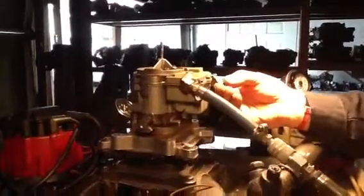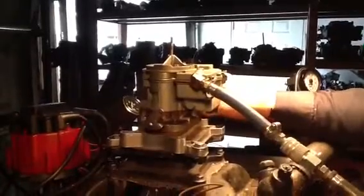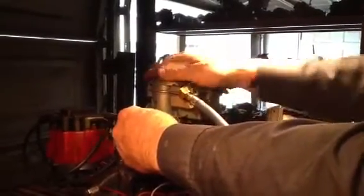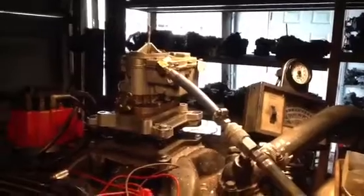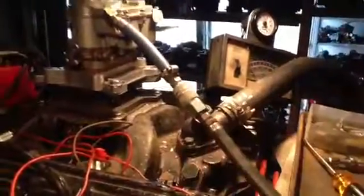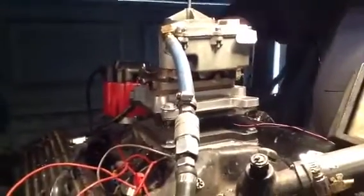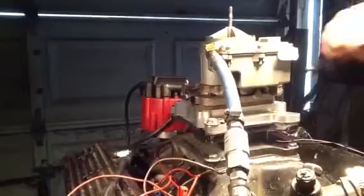This is the other large outboard carburetor, 702 4178. I'm gonna guess this is the back one — doesn't make any difference. They're not gonna run until there's major work done. Thing of it is, they're set up for leaded fuel, and the passages in there are just tiny — the size of a hair. You start running fuel in there that's got 10 to 15% alcohol in it, you don't get enough fuel. We have to get in there and do our modifications to them. We've done lots of these things before — we're the only guys around that I know can even do them.